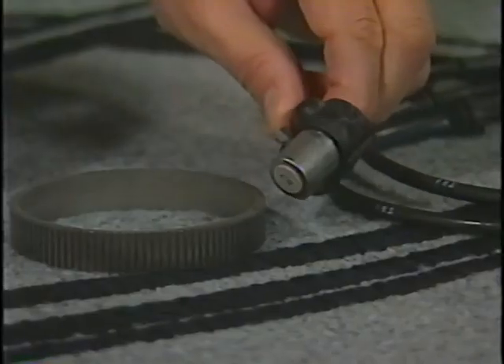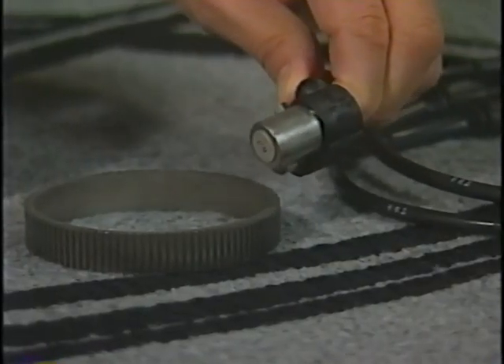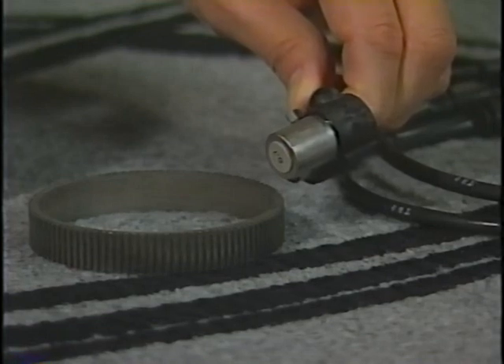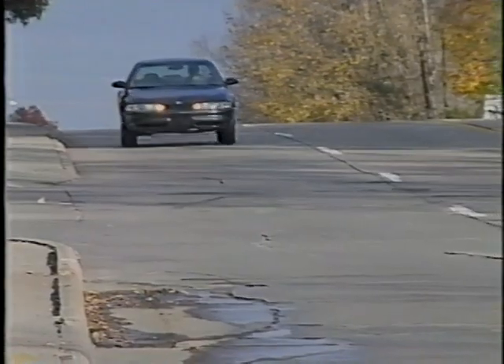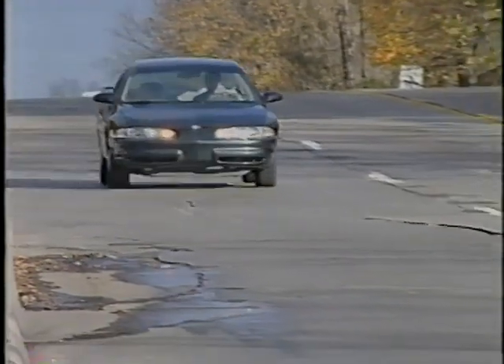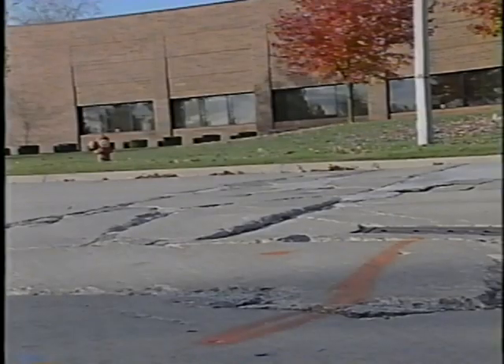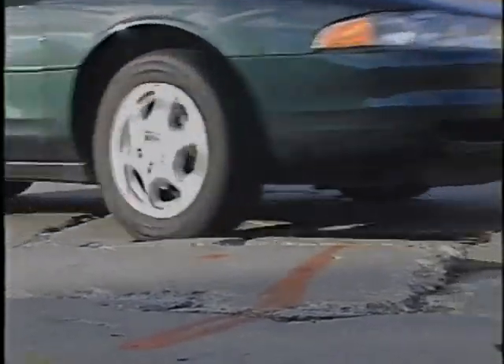On some older vehicles, you may see discrete wheel speed sensors. With this type of sensor, you should thoroughly wet the sensor itself as well as all of its exposed circuitry. Next, drive the vehicle above 15 miles per hour on various types of road surfaces, over bumps, and making turns, for at least 30 seconds. If the indicator light comes on, you have good evidence of a short to ground in the immediate sensor area.